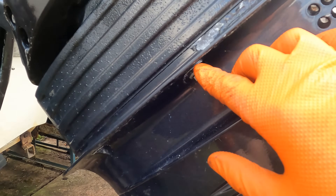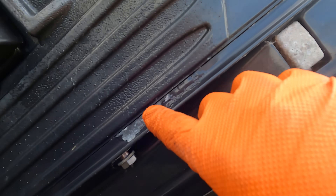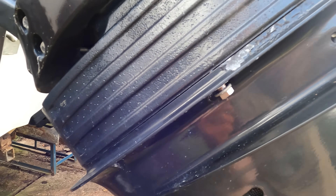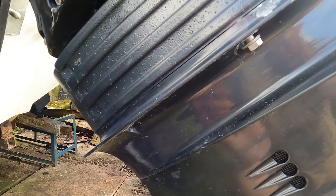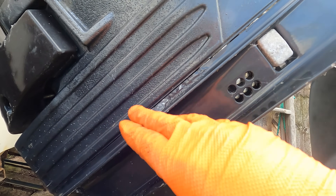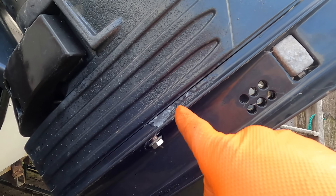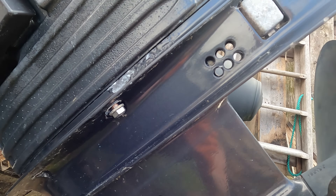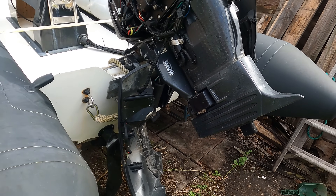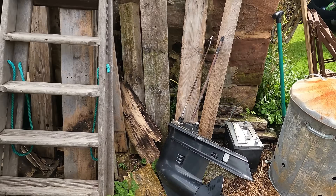I've slackened that bolt off and you can see the thread there. You can see the crack starting to appear as we give it a few taps — it's starting to open so I'm happy it's going to come away. I'll take that last bolt out now — I need two hands for this. Once it's out, the whole thing should slide straight down. Remember you've got a shift shaft and a power shaft, so don't try to pull it on an angle — withdraw it fully. That's the leg off now — didn't take much.